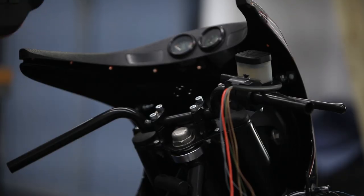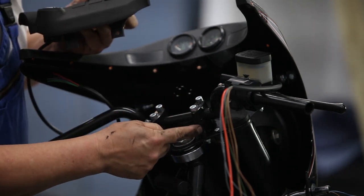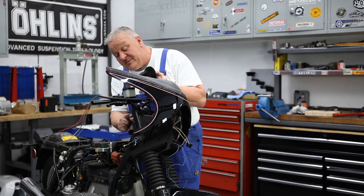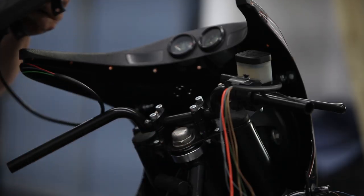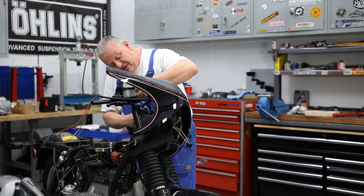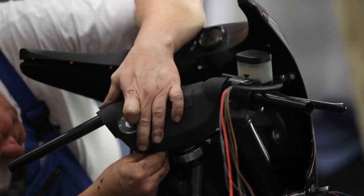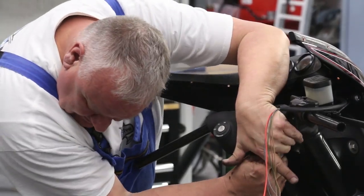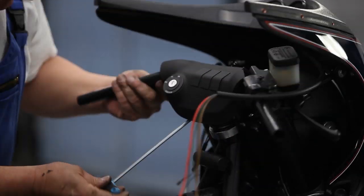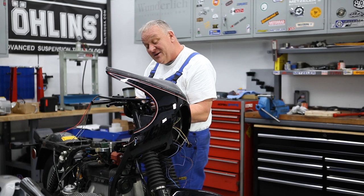This is a K75 dash pad with K75 handlebars. In case you didn't see the earlier episodes: what I did was I took these lower handlebar clamps and drilled and tapped an M6 by 1 hole in there — scroll back to a few videos for more information on that. Now this will fit nicely on here. Does that look cool or what? I think so — I really like it.